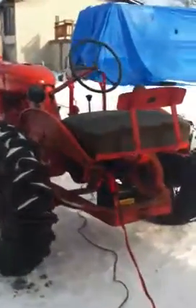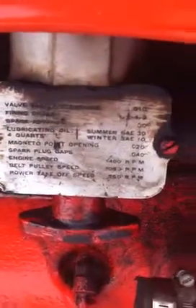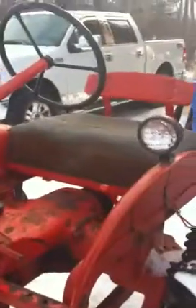We've got the battery charger on it right now. Let me just take a look down here. You can see I've pulled the carburetor off. Not bad for 1938, eh? You can still see the instructions. So, the oil separator, or the updraft carburetor, had filled with some fuel because the float was sticking. We had a float that was punctured and it was filling with gas. So we had Roddy separate that, then he drained it and welded it back together. We're going to bolt that back on and hopefully we can have Ellis back in shape.